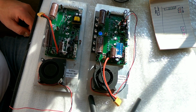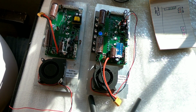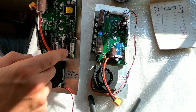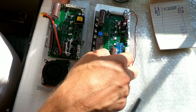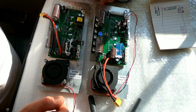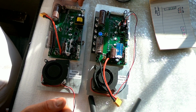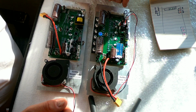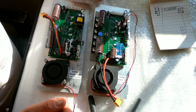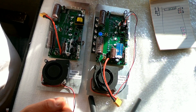Alright, so after having looked at the schematics, most things appear to be the same actually. Like I said, there are a couple of differences. If you look here, their original board has 3 connectors here. The new board over here has 4. Just use the right most 3 ones. That should be the same. Here, this was the old fan negative, and that's already connected there, so you don't have to bother about that, if you're like me and have these things all connected from the start. Apart from that, these 3 are the same, so connect them in the same place.